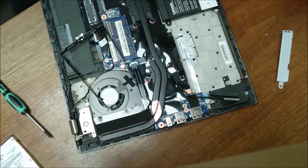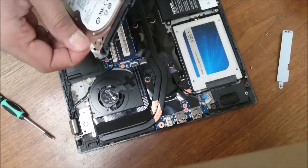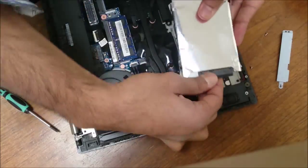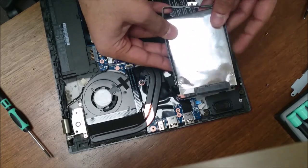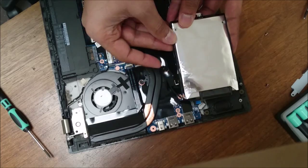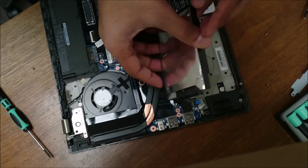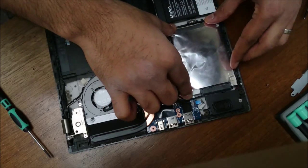I can throw my new SSD in. When you put the retaining clip back on, put it on so it's flush on top — there are ridges here, you can see it's a little raised, and those go back in this way.